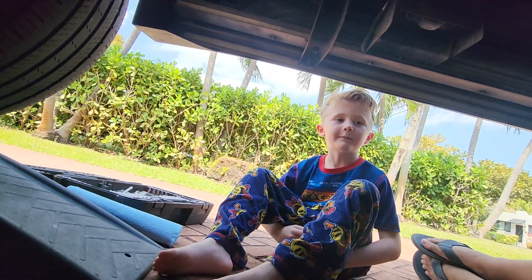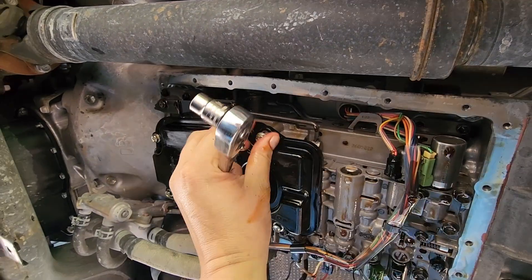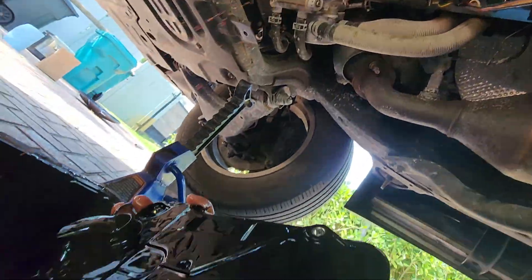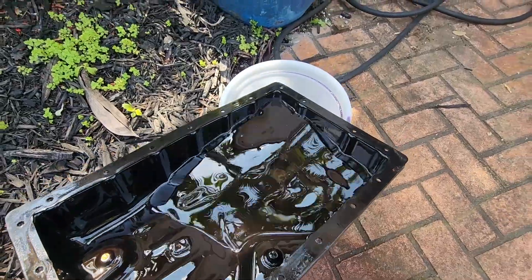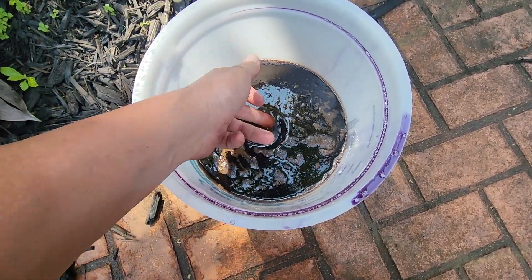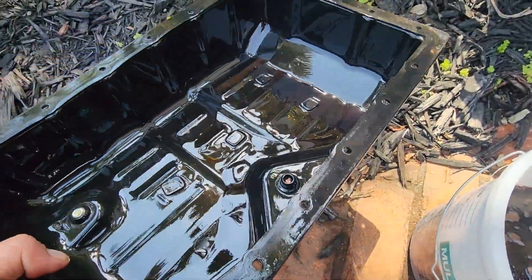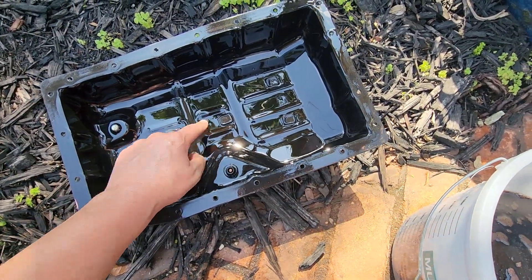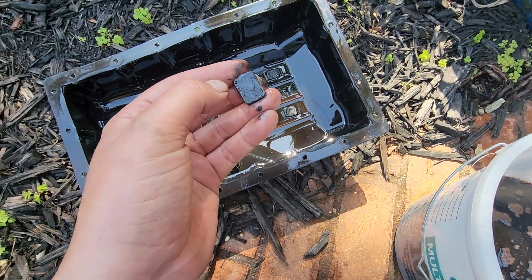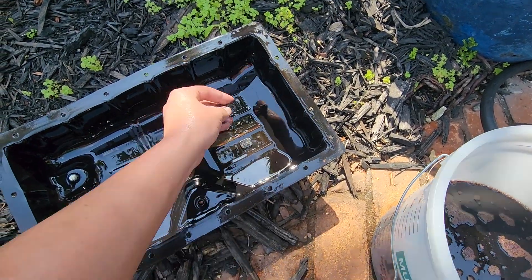Around the perimeter we've got a bunch of solenoids — one of them might be faulty, so let's check that out. Remove the filter by pulling out four bolts around the perimeter using a 10-millimeter socket, then pull off the filter. Let's dump the pan fluid into our bucket and take a first look. The oil is brown — not incredibly horrible. I'm checking for metal shavings indicating transmission wear. There are four magnets in the pan that slide out for inspection. Nothing's horrible at first glance — there are small shavings. Use a rag and clean it all up.